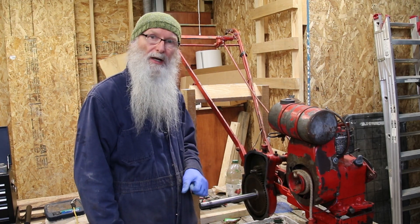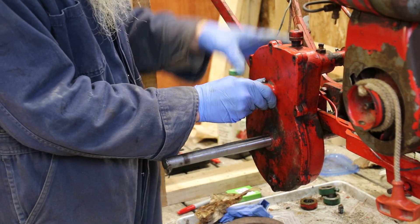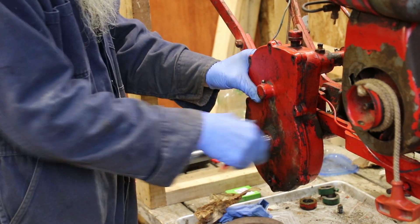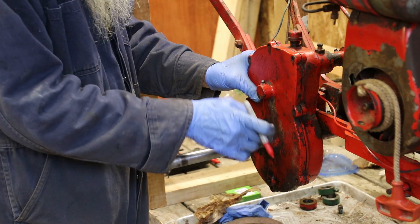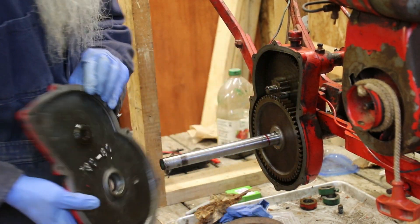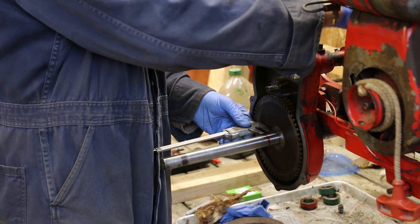Because they're not a felt seal and they're not as wide, I want to see whether or not those pinholes are going to cause me any grief. To do that, I'm going to slide the cover on without the seal in it — it hydro-locks on the bushing there, so you've got to give it a spin — and then I'm going to take a marker and put a mark on the axle where the outside of the housing will ride. Then I can figure out where that seal will ride because I know how thick that flange is. And that puts me quite nicely outside those pinholes.